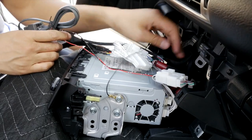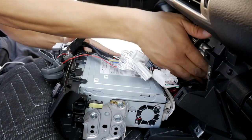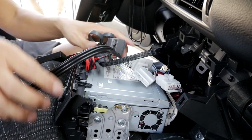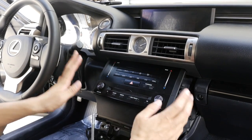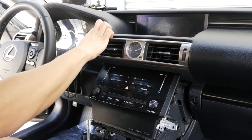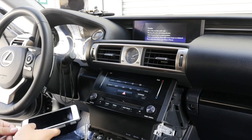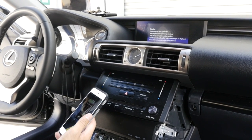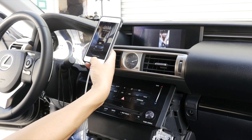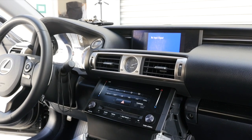Now that everything is connected, we're going to fit all our harnesses and adapters behind the radio — there's some room back here and up here. Make sure the switch is set to TV for this model without factory navigation. We just finished organizing all the wires and adapters behind the unit. Before putting everything back, let's confirm everything works — turn on the car, get your iPhone or Android, and connect it. The phone is charging which is a good sign. Looks like the phone is mirroring as it should. Now that we've confirmed everything is working, let's put all our panels back in reverse order.